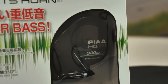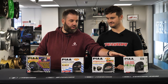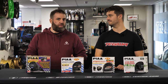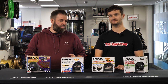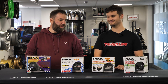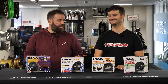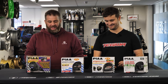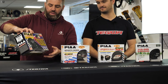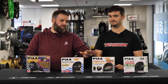So we've got deeper ones down here — 330 and 400 hertz. These are dual tone horns, so we've got one slightly deeper than the other. That's why your German cars — BMW, Volkswagen — they have a much louder, deeper, manlier sound to them, whereas the Japanese ones just have a single tone, quite high pitched, just a polite little horn because they use it differently over there. So we've got deeper ones over here, and then we have higher pitched ones over here at 500 and 600 hertz, and then just mixes in between.